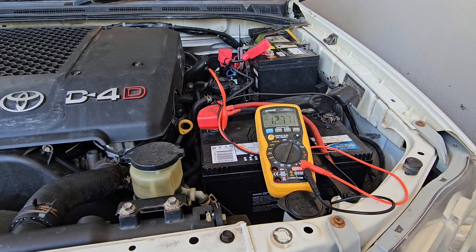I've had this battery on charge for a little while. It's showing 12.7 volts. Around about 12.6 is a charged battery. Anything below that means the battery is not fully charged. Now that we've got our voltmeter connected, we will start the engine.